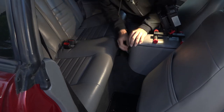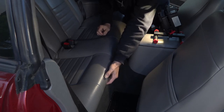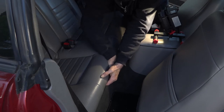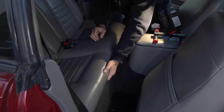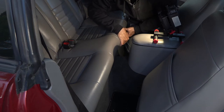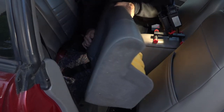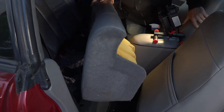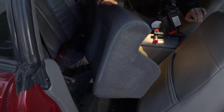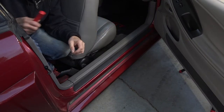The first thing you have to do is remove the rear seat. Right in the center underneath there's a button — it can be kind of hard to find — push that button and then pull up on the seat. Do the same on the other side: find that button down in there and pull the seat up. Get your seat belt through those holes, poke them through, and the seat comes right out.